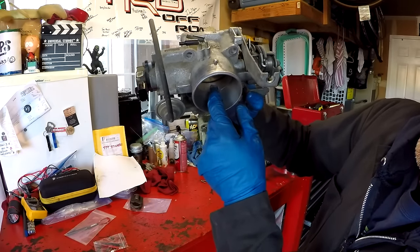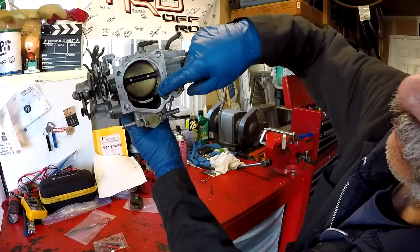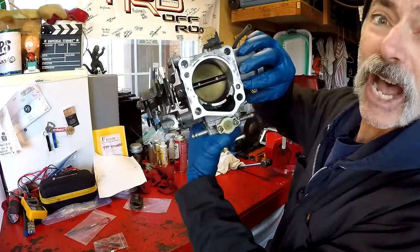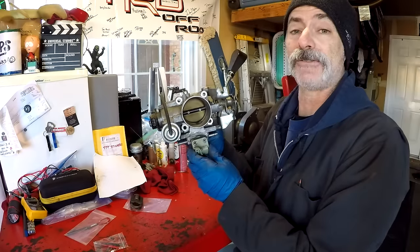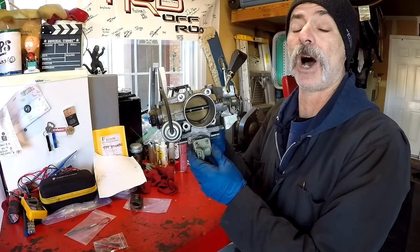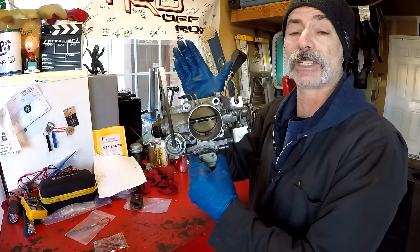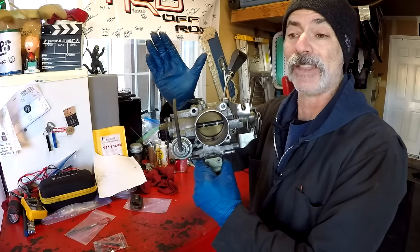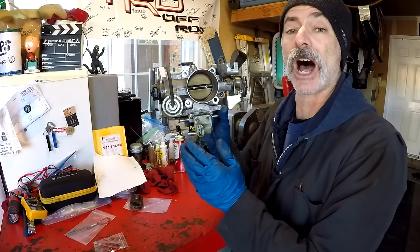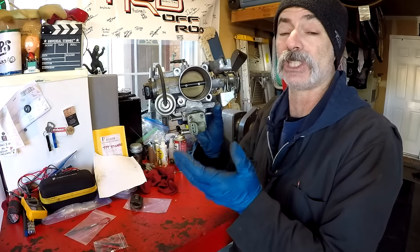There's a port in front of the plate, and looking at the back side you can see a port that exits the back of the throttle plate — that's how your engine gets the air it needs to run. The IAC valve doesn't just open at idle; it also opens under deceleration. If you're at highway speeds and take your foot off the accelerator while RPMs are still high, the IAC valve opens to give your engine the air it needs.